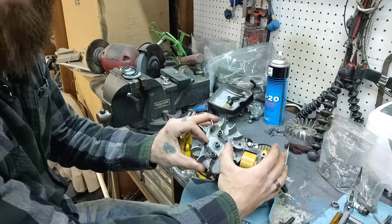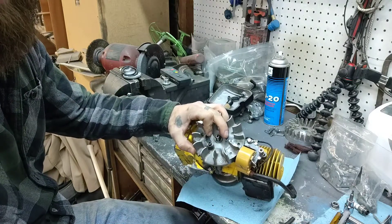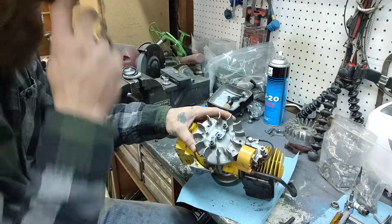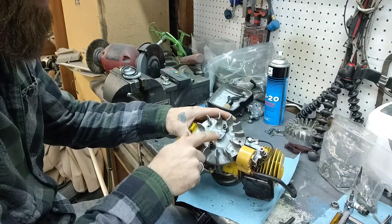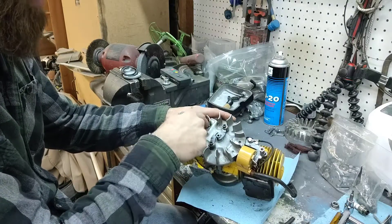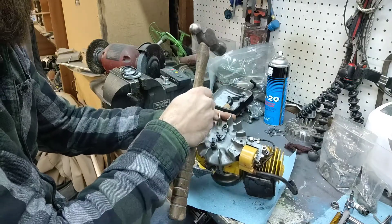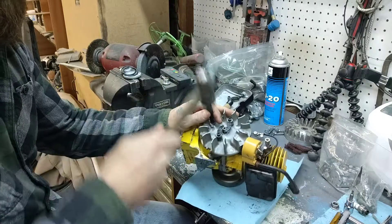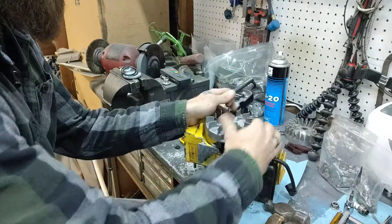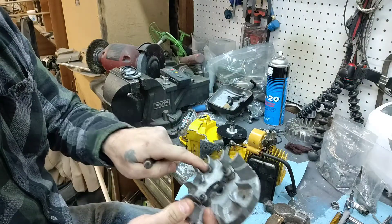A little trick here: there is a key slot — that little slot that's in there. The key holds it all in and it's pressed on. What you can do, from the opposite of that key slot — so if the key slot is facing this way, on that opposite side, on the far side — take your punch or your hammer and you can give it a little tap, and that will pop loose. Make sure you turn the magnet away from the coil. One little tap, but you have to do it on the opposite side of that key slot.